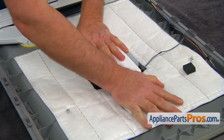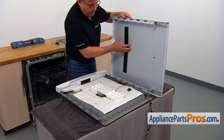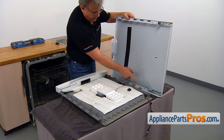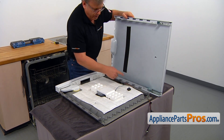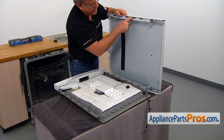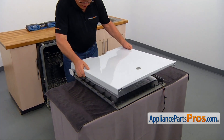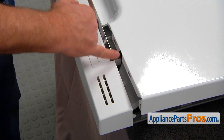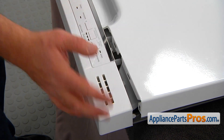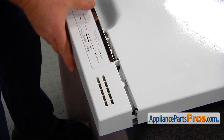And now we're going to join the inner and outer doors together. This is the outer door. This is the inner door. We'll have cuts on both sides of the outer door, and tabs on both sides of the inner door. So these hooks are going to lock into the cutout. Place the door on top. There are a number of cuts in the outer door panel on the top, which match with the tabs on the control panel on both sides. So we're going to lock the tabs on the door and then push it forward.